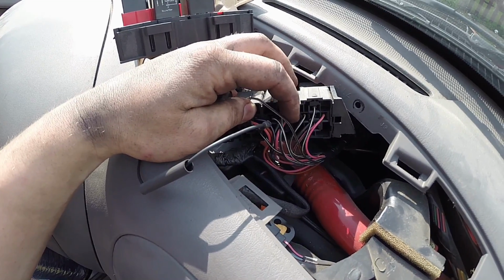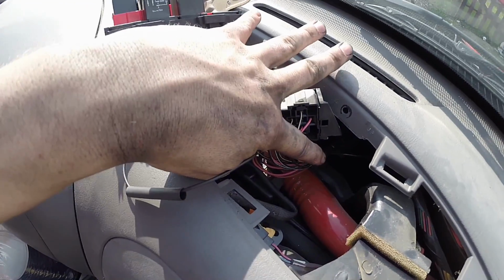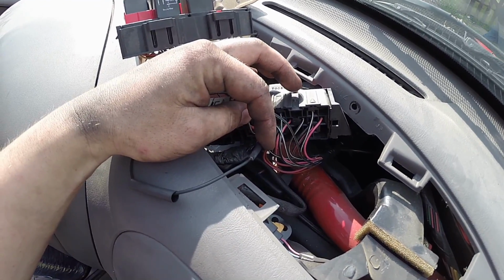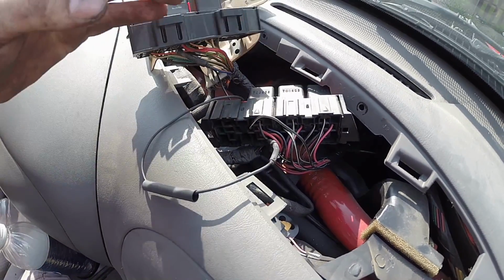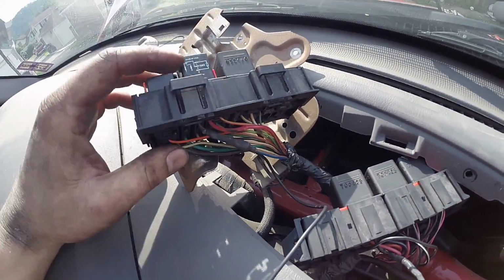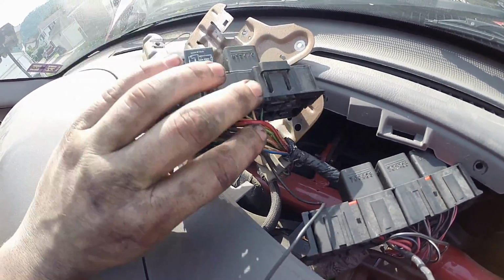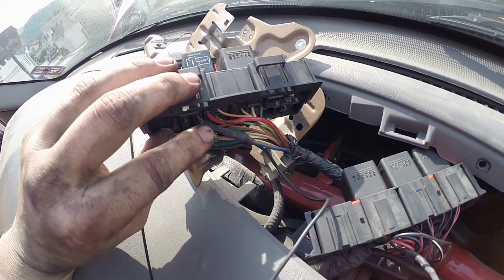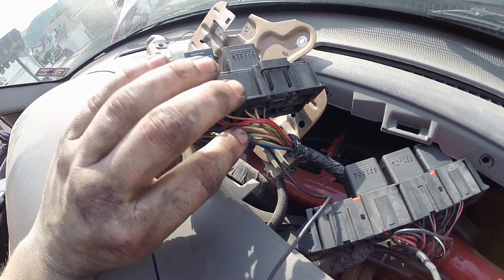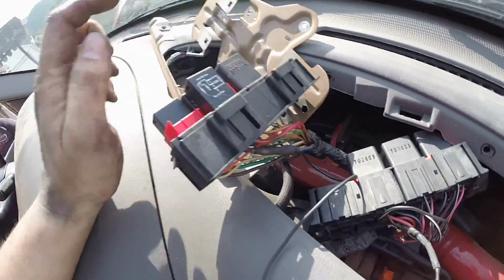So I knew that was the power door lock relays, so I just had to get power to them. Once you get power to one of them, they're going to splice off down here in the harness and come back up to here. So they're all going to get power, just giving power to one of these. And like I said, they're low amperage, so that's just fine for repair on there. And then I brought a wire over to right here. That's the transfer case shift motor relay junction block right here, and this was a nice 14 gauge thick wire right here. So we tapped off of that, we spliced it in there and sealed it up, and that way it's secure in there. I'll wrap some electrical tape around here, secure it all up, and put these blocks back down in there in the bracket right here.